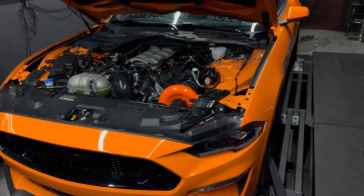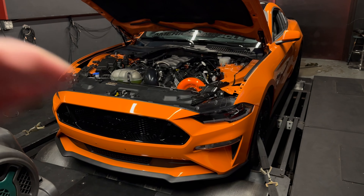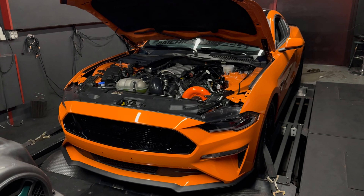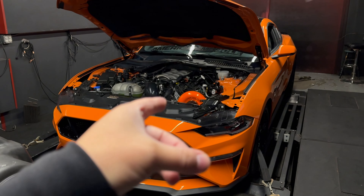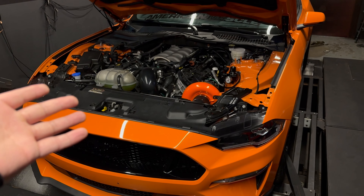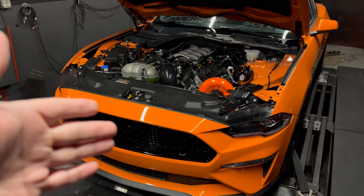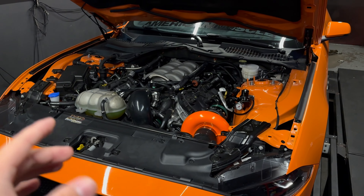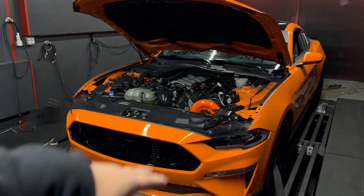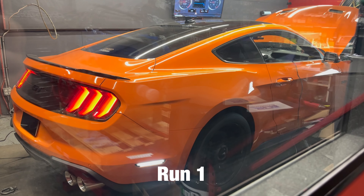Depending on what we make on the 100mil pulley, we may or may not switch to the 90mil pulley. We're shooting for right around the same horsepower numbers, but if it makes more, it makes more. As far as boost goes, we're really not trying to do anything too crazy — stock block, stock internals — so not looking to make any more power, but we do want to see a better power band than the ESS G3X on 100mil. This is a direct comparison: G3X 100mil vs G3R 100mil. Fuel system is on 1000cc injectors with a triple fuel pump setup.